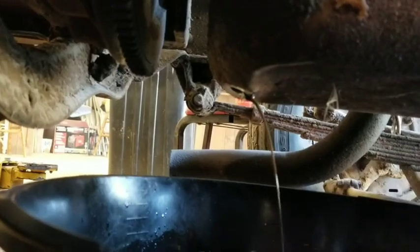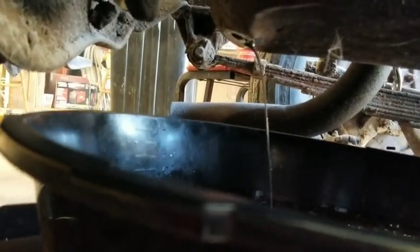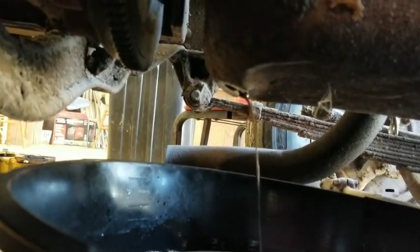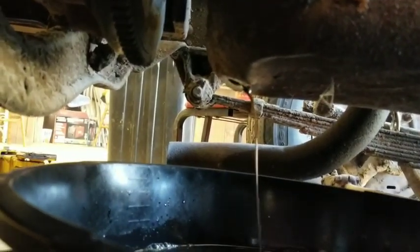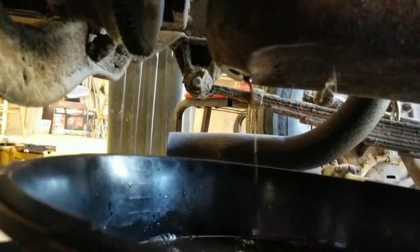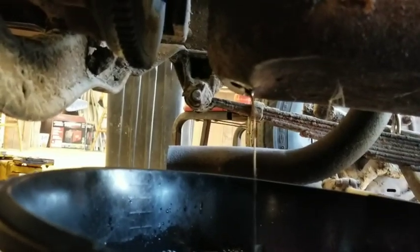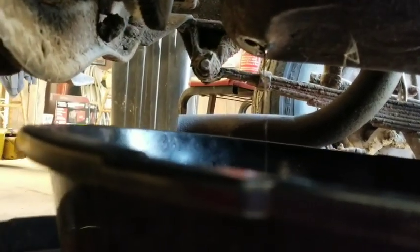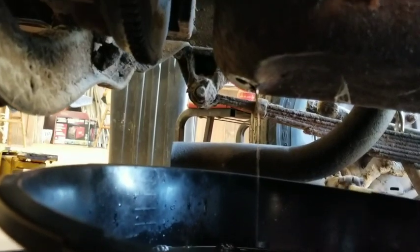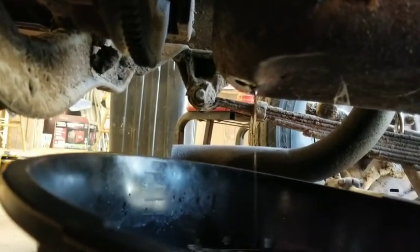All right, well, I don't see any clumps or chunks, which means that diesel fuel sitting in there for 2 days while I waited for parts, and running it the little time I did, circulated that diesel fuel through the motor and the oil pump and all the oil passages and cleaned all that stuff out of there. So now the engine should be fairly clean inside. We should be able to put fresh oil in it and should be good to go.